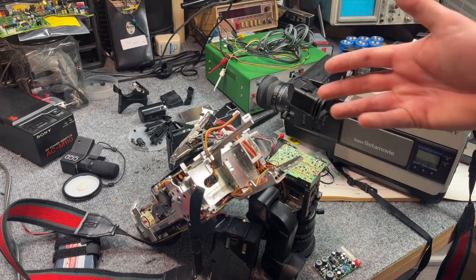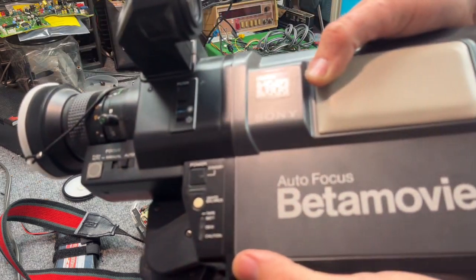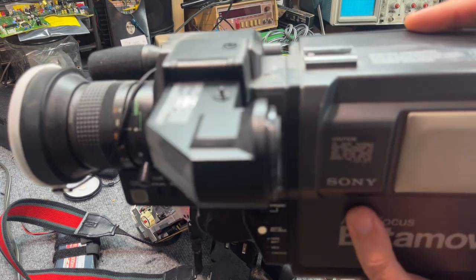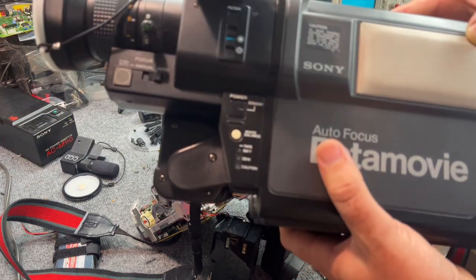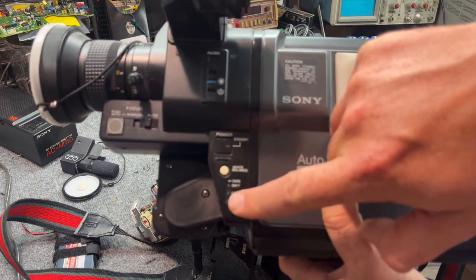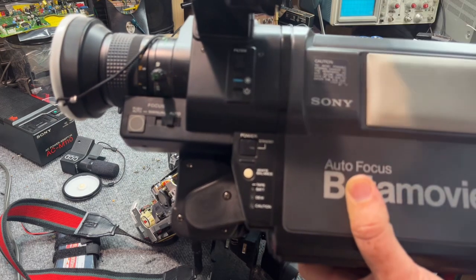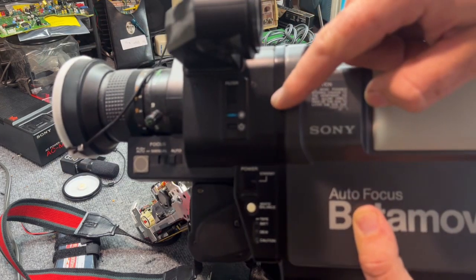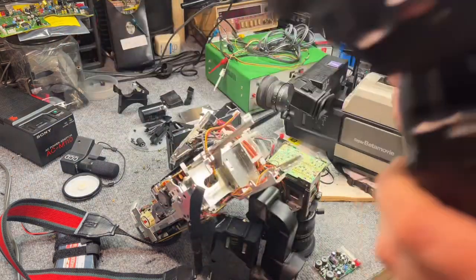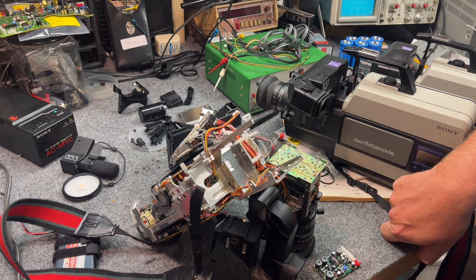Not to be confused with the older tube models like the 220, which I have here as a parts unit. This one has a dead tube, which a lot of them seem to have. A good way to tell if you're going to have problems: apply power, put a tape in, and if the caution light stays lit, that's a sign something's not right. You may also see in the viewfinder that the low-light indicator stays on no matter how bright a light you point at the lens.